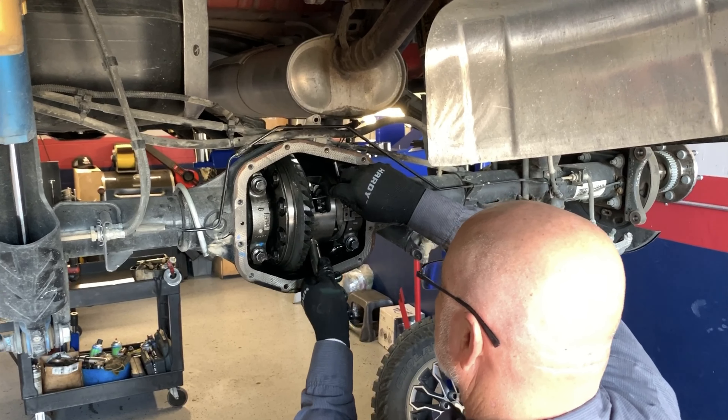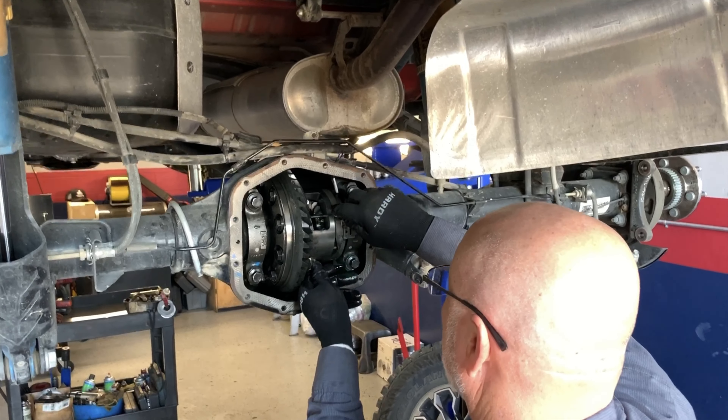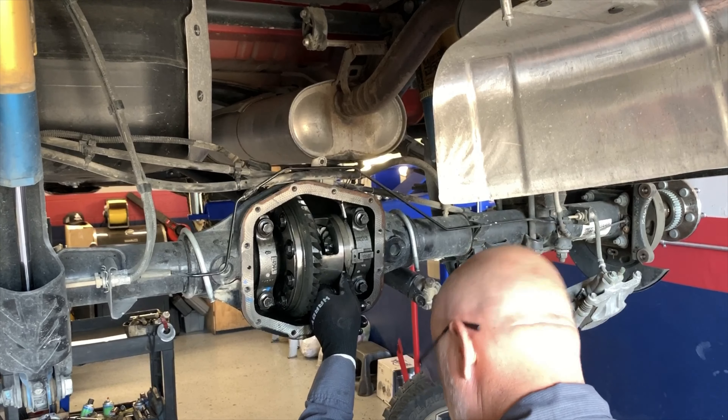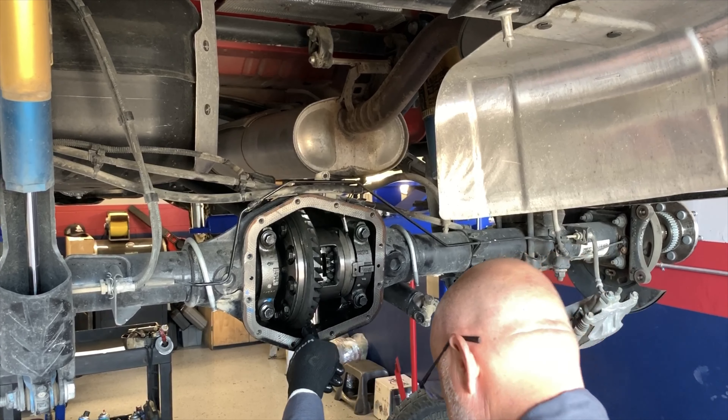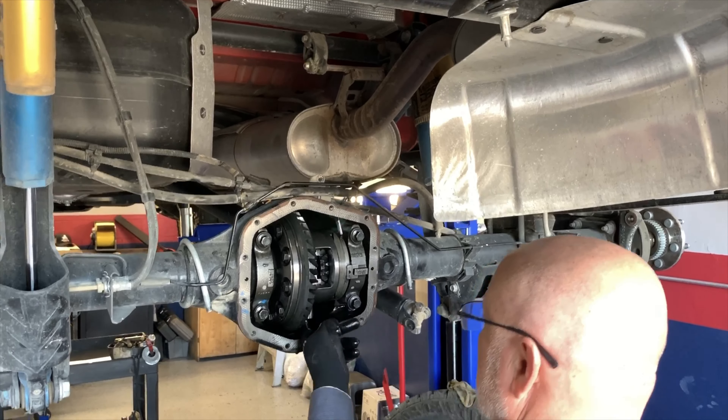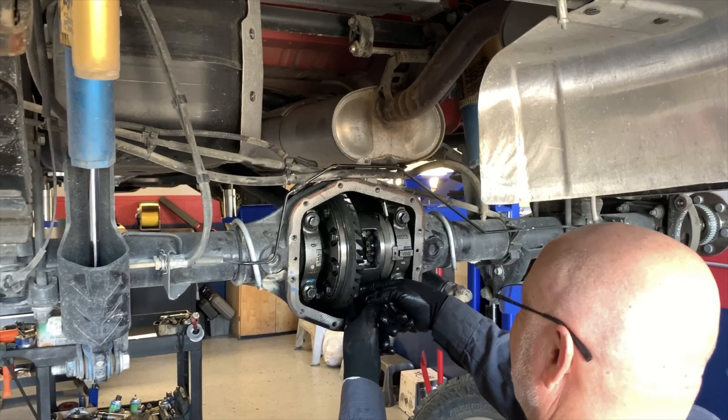It was noticeable — the loss of power with the 35-inch tires and the loss of fuel economy. They're also going to install a module under the dash that will help control shift points and a lot of other things. If you don't do this as part of the process of upgrading your gears, your vehicle may go into a limp home mode. When you're off-roading and losing traction, gears shifting in different mechanisms can throw signals to the computer causing it to go into limp home mode. So you have to do the computer module update so that everything is still working together.